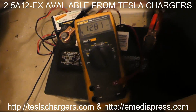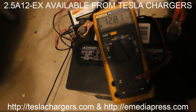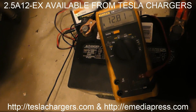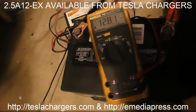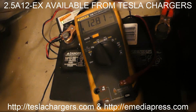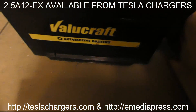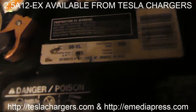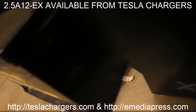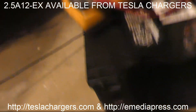It's about 9:30 the next morning, so it took about a day and a half. It's resting at 12.81 and I have no doubt that it's going to start right up like new. I'll go ahead and put it back in the truck and see if it starts — see if we can save this 59VL battery, manufactured 3/10, six and a half years old.